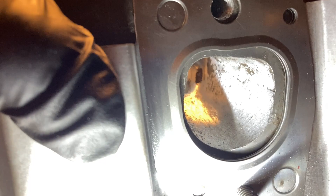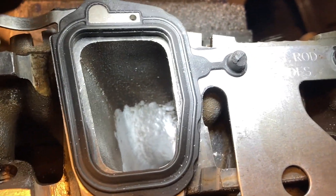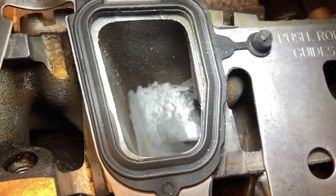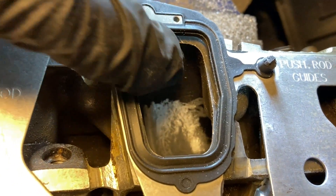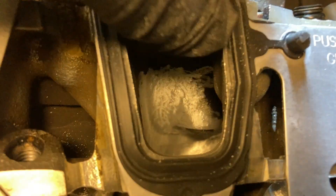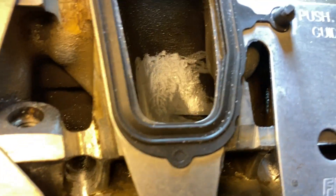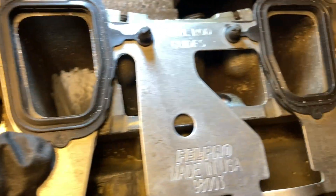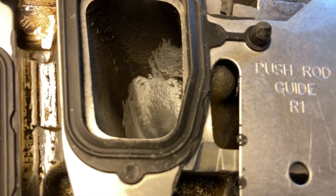Got the head flipped over with the intake gasket on — you can see again how much room there is to port match on this side. There's quite a ridge right there where it dips in, definitely not a good flowing area. I've been taking material off and cleaning it up. My next job will be to port-match around all three ports, and we'll also check the intake manifold to make sure everything lines up for a nice free-flowing intake.